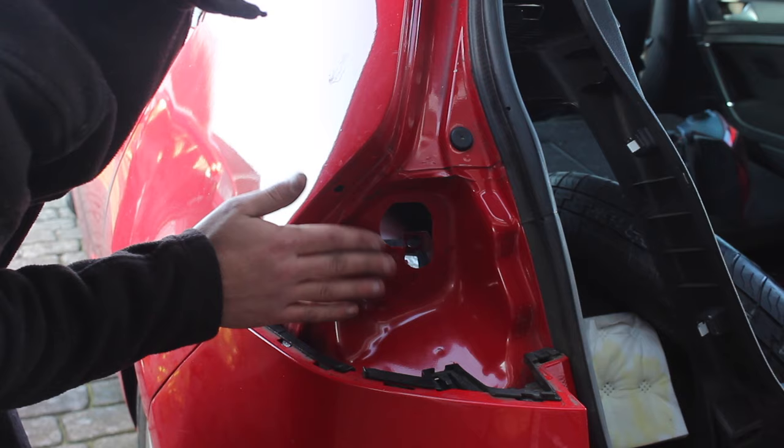There's a drain hole in the back of this boot badge with a tube that runs inside the boot to let the water out the bottom. And we have a look here. If this goes inside the boot, which often it does, then it's going to be leaking inside the car, inside the boot. So if you're missing this part, the chances are it's underneath here and you need to replace the tube which goes from the badge down to here. I've had this before and I made my own up because I didn't want to buy the part, but I'll put a link in the description to this part if you want to get one.